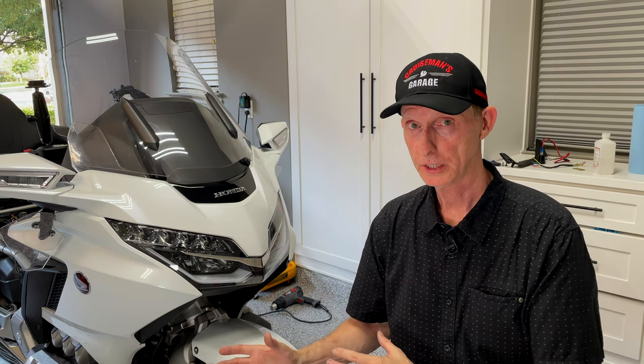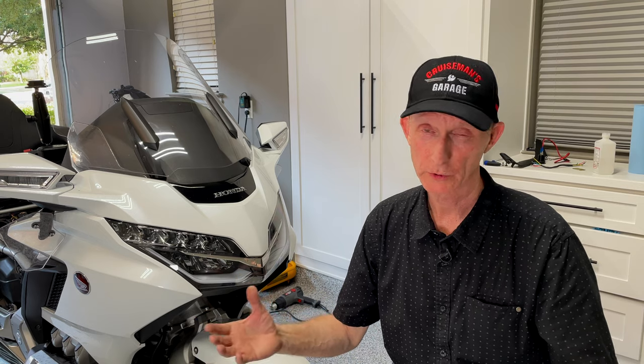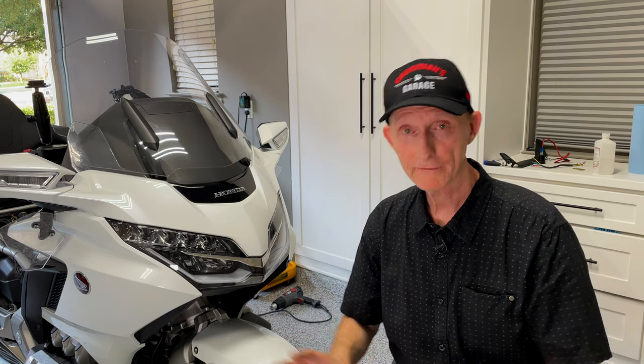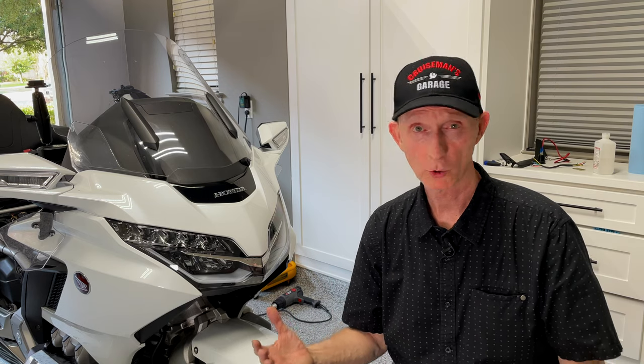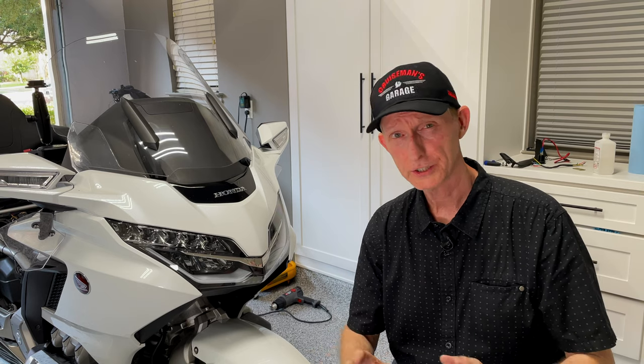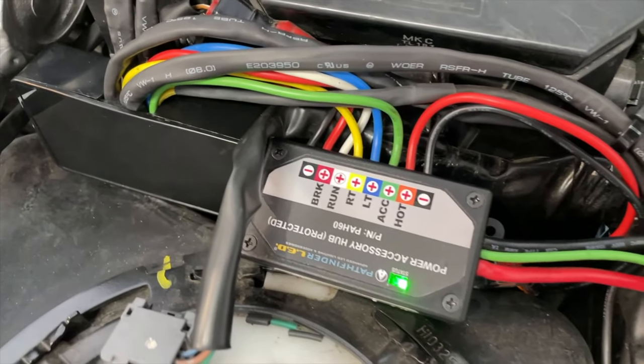There's no way I could have fit everything in that junction box if I hadn't switched over to those new connectors — I would have needed a bigger junction box, and I'm not even sure that would fit under the seat. I was able to eliminate two junction boxes that were on the left side of the bike — they were really just plastic boxes I was putting WAGO connectors inside of. I was able to pull everything into one central location, which I think is more elegant. Even though I had to extend some wires using solder connectors used with a heat gun — I'll put links to those in the description because they're invaluable — so much easier than getting out a soldering gun.